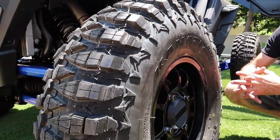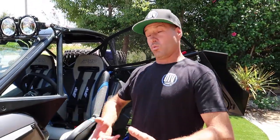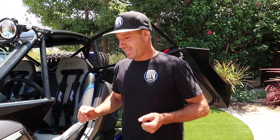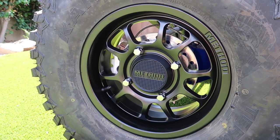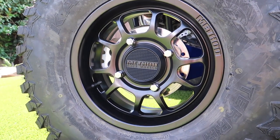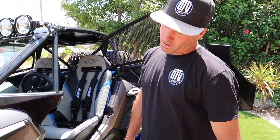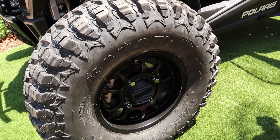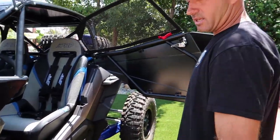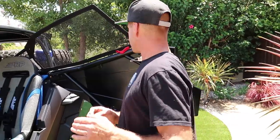When we got into the wheels, I asked him: do you want to be changing out bead locks or not deal with that? His response was he didn't want to deal with that. So we went with the 409 Bead Grip Method wheel — it eliminates the need for bead lock rings, has an inner lip, it's a reverse mount, looks awesome like a little mini rally wheel, powder coated black. With this tire combo you can air down with no need for bead lock rings. We can also put paddles on this setup if needed, but he said he's riding in the desert.